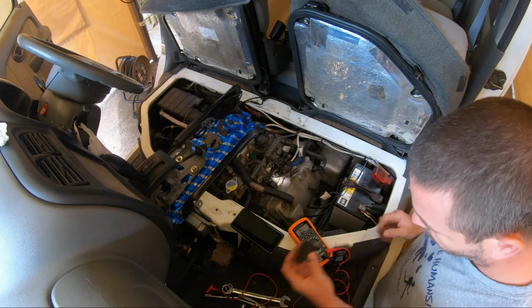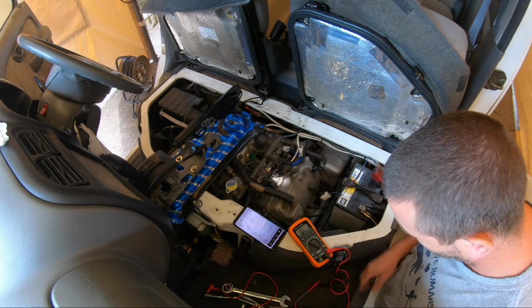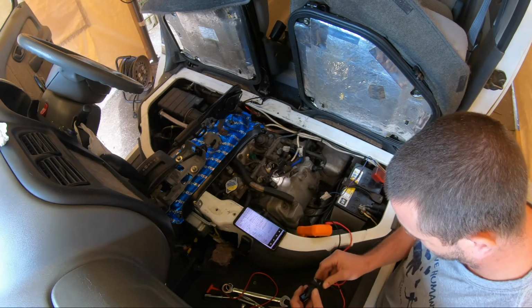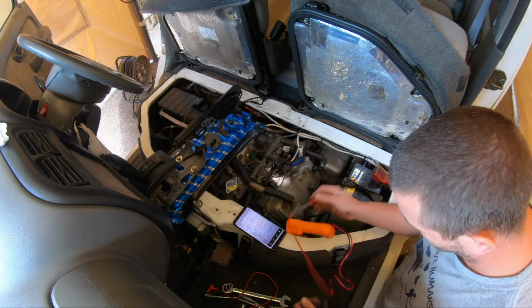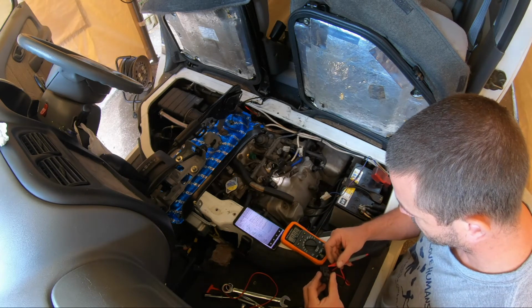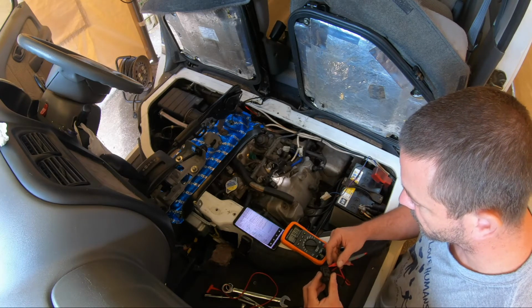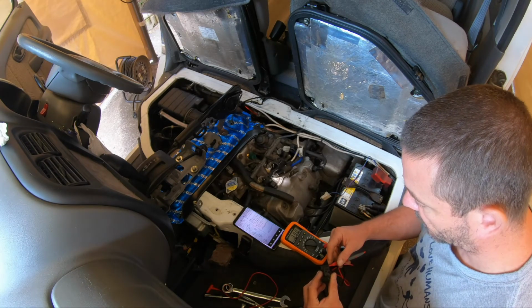Yeet. This one, at 20 degrees, it should be 37 to 41 ohms. It's not. It's higher than that, quite a substantial amount higher. Please stay there. Now we've got 39 ohms, which is correct. So maybe it was the fact that I ended up with the correct resistance values and forgot about the problems I had in the past or whatever.